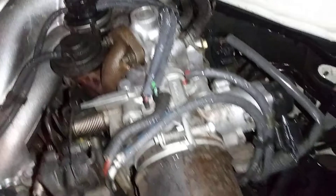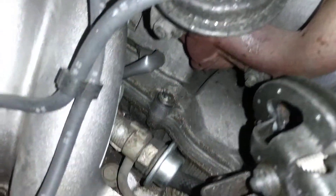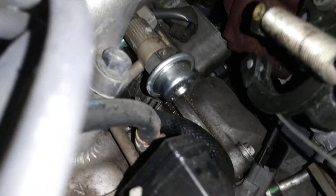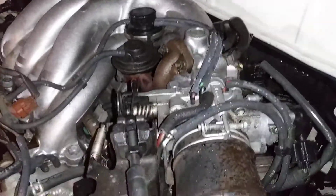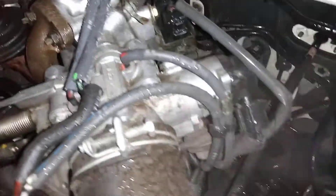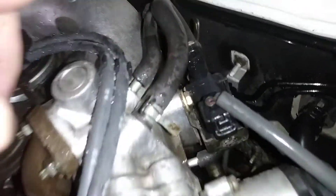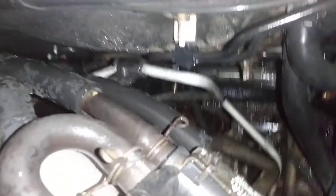So you've got three vacuum switches here that I can see. And then this must be a separate pressure regulator right here. There's nothing going on on the fuel rail — I've never had to replace those yet. And then you've got two vacuum lines that ride back from here, down to the power steering assist. They both go to the power steering assist.